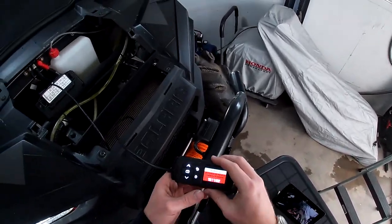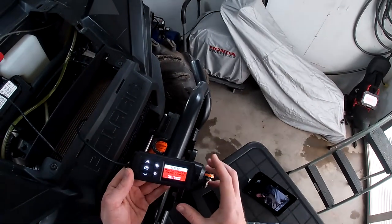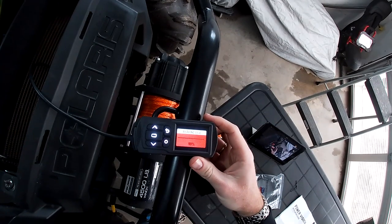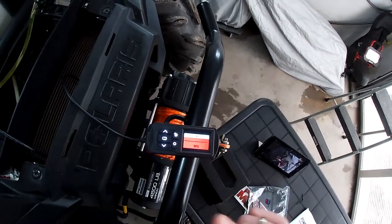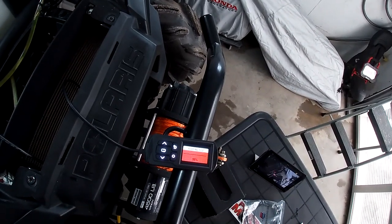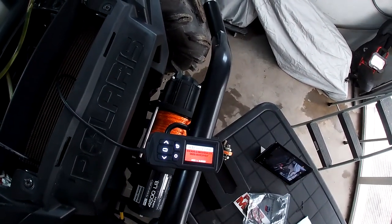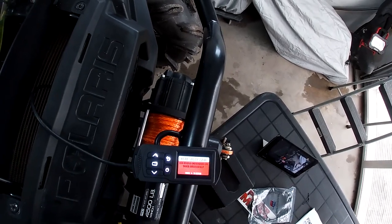I'm going to shut the lights off and disconnect the fan as well. Let me catch back up with you guys once this thing's actually read. We're almost done — 99 percent. I also realized when I left you guys I was supposed to hit the square button again to start the read, but it actually didn't take very long — maybe 10 minutes to get to this point. Read successful — ECU read complete, stock file saved: vmb564b8ho.stock successfully saved.